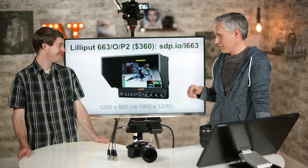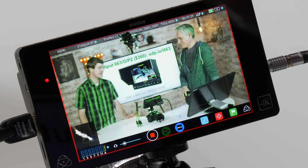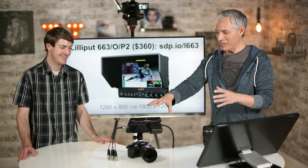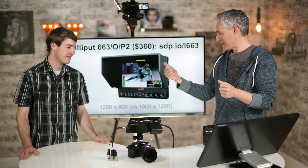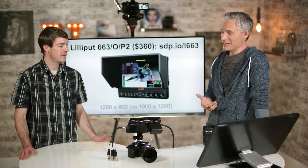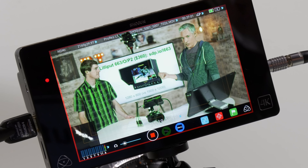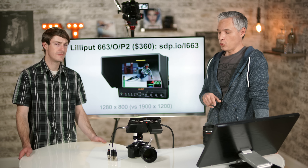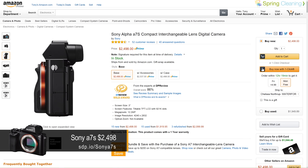On battery life: with the larger battery you might get about an hour, but the smaller included battery constantly needs recharging and swapping. The Shogun comes with a tiny battery that records maybe 20 to 30 minutes — and since you spend about 15 minutes just getting ready and checking exposure, you might only get 10 minutes of actual recording before it dies. You have to buy a bigger battery, but they're cheap non-proprietary Sony-style interchangeable batteries — around $20 — so you can just get a bunch of them.